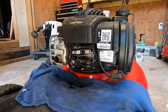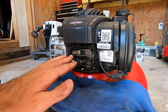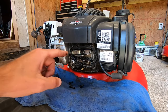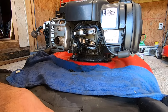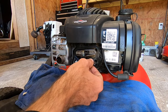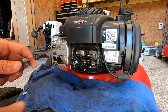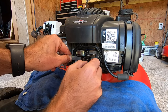The set screw in the middle was very loose. At this point, what I like to do to set my valves - there's a couple different ways, I'll show you the way that I do it. I want to make sure that the opposite valve is depressed from the one I'm trying to work on. We're going to work on the intake valve clearance first, so I want to make sure that my exhaust valve is pushed down. You can see as I rotate it's coming back up - so that is all the way down. Right off the bat this is way, way, way out.